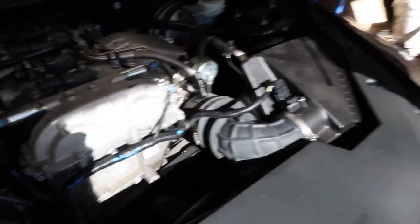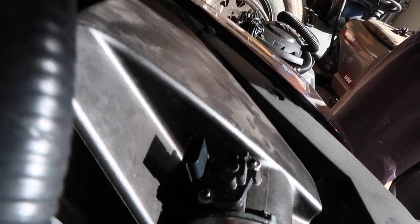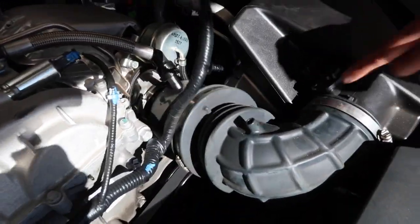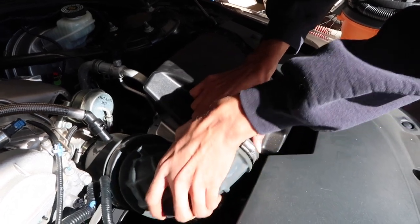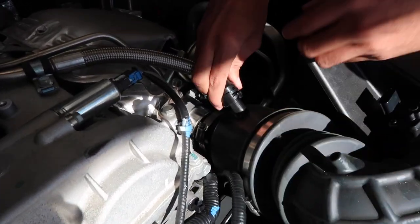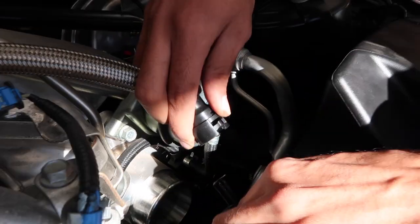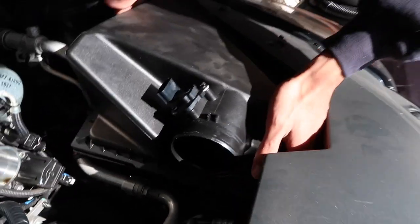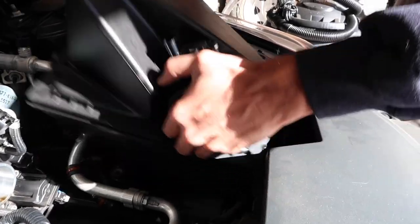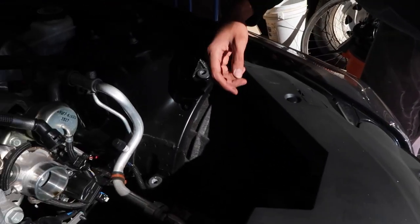You want to take this MAF off. There's a little red clip that you're going to have to pull back, and then there's a little button and you simply just pull it right off. This will come out as well — just put that to the side. Make sure to plug that in and not leave it in your fan like I just did. After you do that, this should pop right off. Then you want to remove this breather hose — you make this little lever go to the right, and simply just pull it off like that. This is what we're going to be removing.